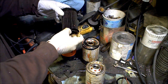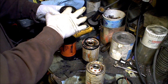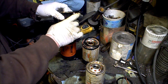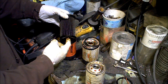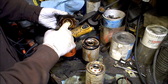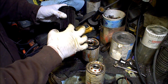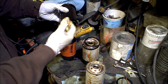The thing that I don't like about this style filter is where the pressure relief valve is. Oil comes in through those holes, comes across through the body, through the filter media on all sides, into the middle, and out the center hole. When the engine's really cold — and it's debated whether the bypass also opens at extremely high RPMs like redlining — the oil going through the pressure relief valve right here opens up and allows oil to go straight through without passing through the filter media. But it has to come in, wash over the filter surface, and then go back up and out, essentially going through unfiltered.